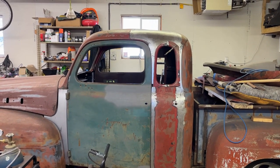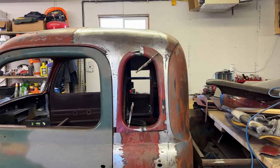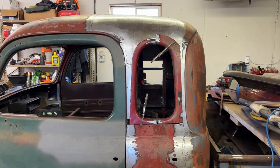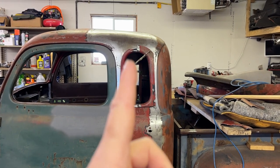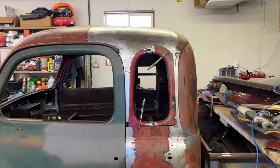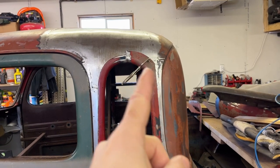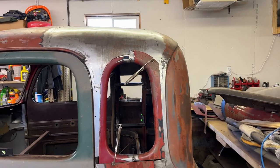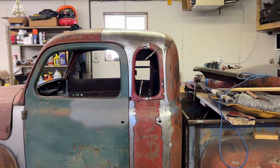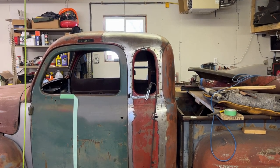It is time to finish this side and this corner window. It's Saturday, December 2nd, the weekend after Thanksgiving. Last time I left off I had just tack welded this window frame together and got it located where I think it'll stay. I just need to make sure this angle is a mirror image of that angle. I'll follow this radius and trim off the top part so it's one solid radius. Now it's time to get that fit, tacked, and hopefully move on to the passenger side.